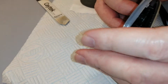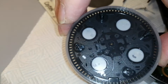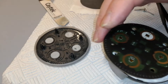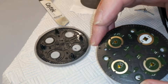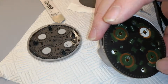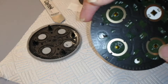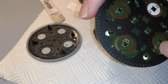The top board just pops out — there we go. There's the button assembly with the light ring here — the light ring diffuser, translucent white plastic. This is the tactile button board with a very dense rubber foam on top. There are your buttons, and there's the outer. I don't know what those gold rings are for — they're not making contact. These little yellow things aren't contacts; these are tactile buttons, surface-mount tactile buttons. Not sure what the gold ring is for on each one.